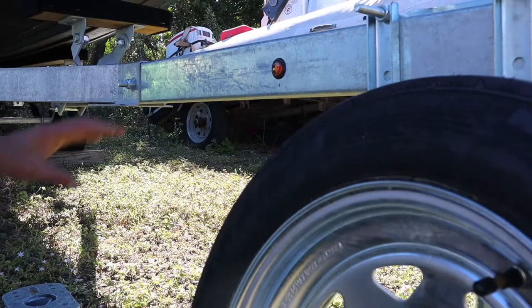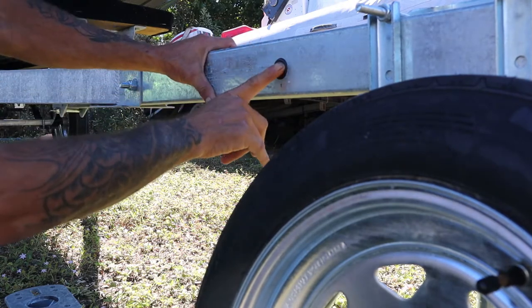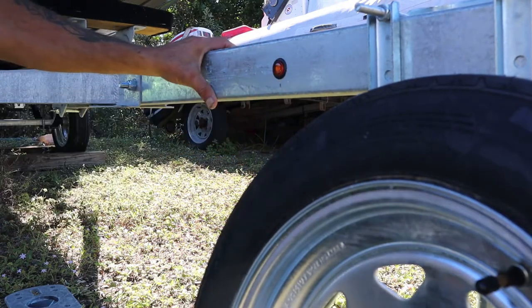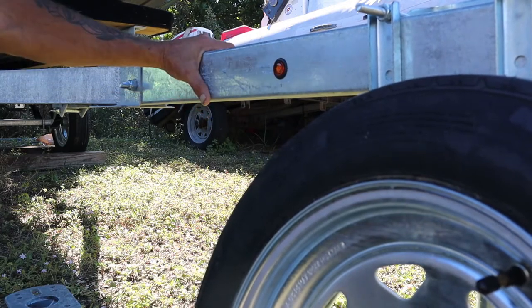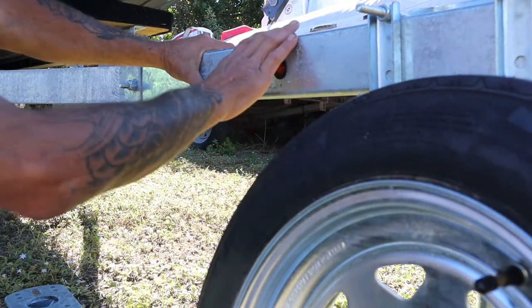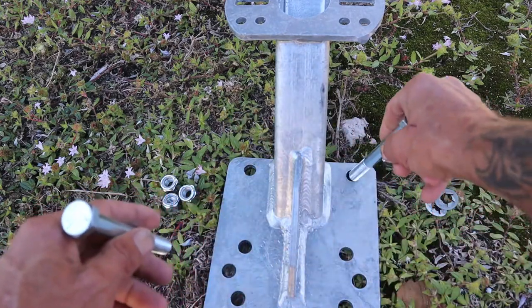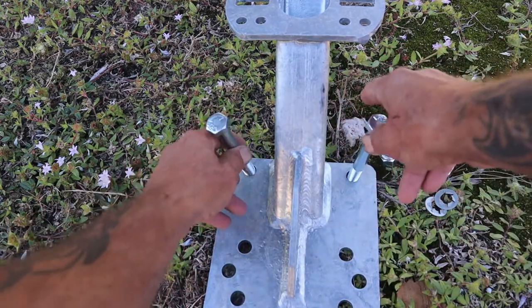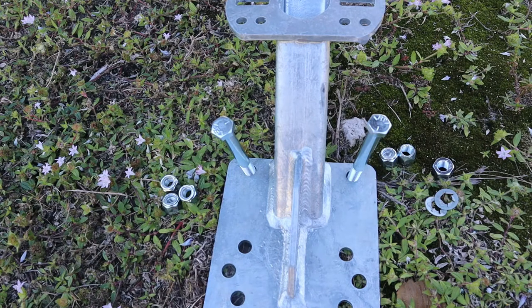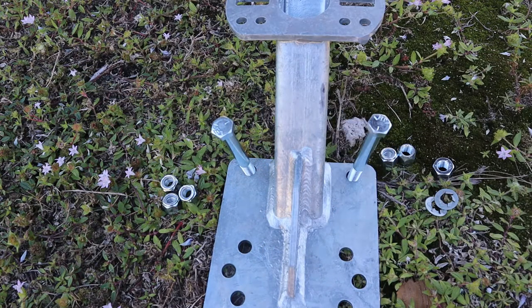Let's go ahead and mount this thing up. This is pretty much the desired area towards the front. We don't want to cover up our little side marker light. So we're going to loosely put this thing up here in position, take a measurement, and see how close the spare tire clears without hitting the bottom of the boat. We're going to start with two of our long bolts going through the two holes at the top, set that up against the beam of the trailer. Then we'll take our two other brackets and slide them through the holes — it actually works almost like a U-bolt.